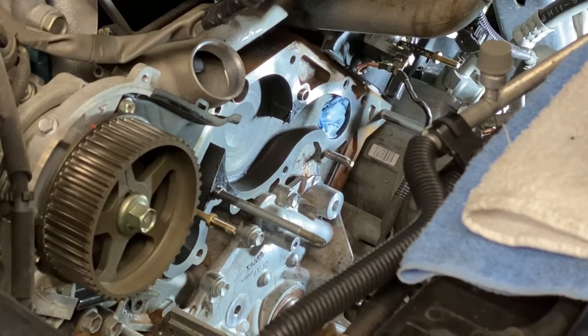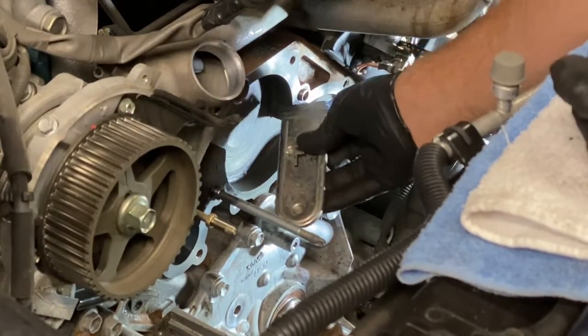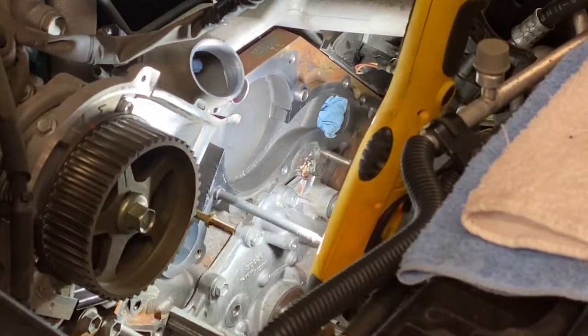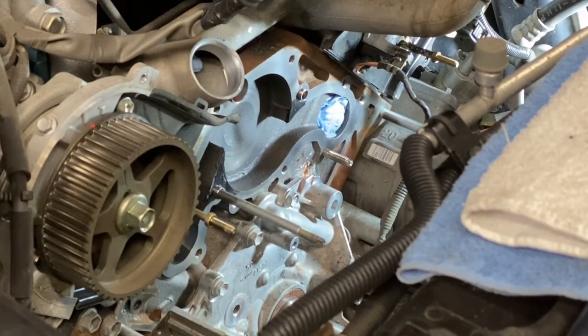Some of these ones, especially getting up around a quarter million miles with coolant system problems because they haven't been properly cared for or serviced, the pitting can get pretty bad. The last thing you want to do is finish a timing belt job and then have a silly coolant leak. The bad part about the procedure is I like to let it cure overnight before I put my gasket on. Typically I try and get my timing belt torn down, get this cleaned up, find out what parts I'm going to need — like maybe a tensioner or a fan bracket — get my FIPG in anywhere I need it, then call it a night and come back the next day for assembly. Hopefully that little trick is helpful to somebody out there.